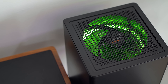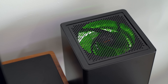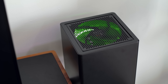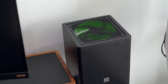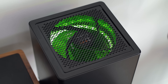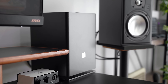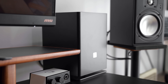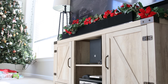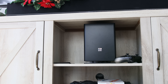Second, we saw that subtle green glow on the top of the Xbox console. So what I did was I threw a 140mm Phanteks digital halo underneath the included 140mm Be Quiet fan on the top of the case. This way you can change it to green in the settings to replicate that upcoming Xbox look, or you can make it glow whatever color you want. Third, this is designed to sit vertically on your desk or an entertainment center, because it's an ITX PC case, whereas the upcoming Xbox is said to sit vertically like we saw, or you can lay it down horizontally on its side to fit more for that living room setting.